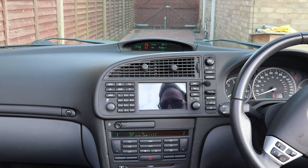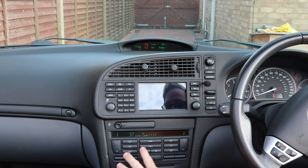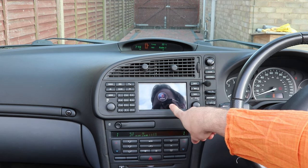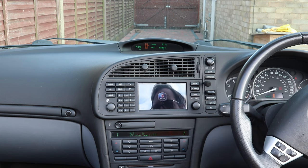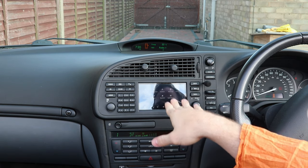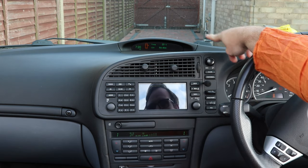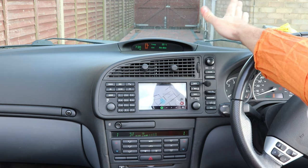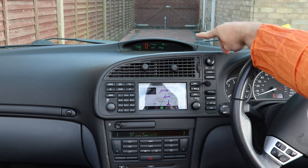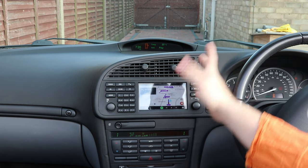The radio still fully functions — you can still tune the radio in, still have preset stations, and all of that stuff still works. The CD player is still going to work. The basic functionality which you have buttons for here still works, but you can see there's a Saab logo on the screen and it's showing a loading sign — that's the difference. Now if you want to have audio from the new modification, you need to press the disc button. The first time you press it, it will go into CD mode as usual, but if you press it once more it will go to auxiliary, and that auxiliary mode is what this unit needs to give you audio.